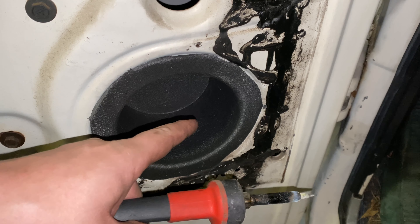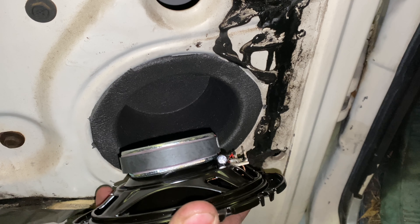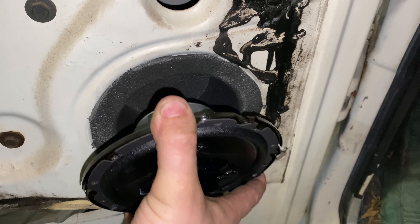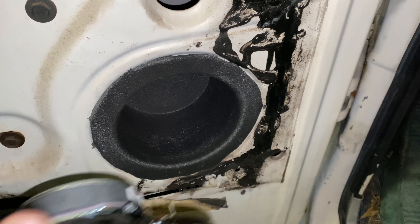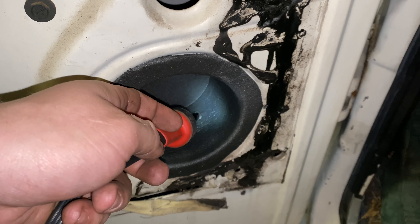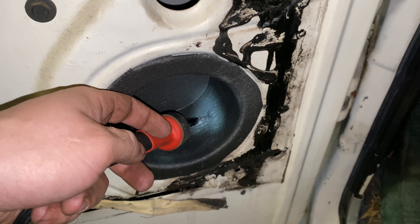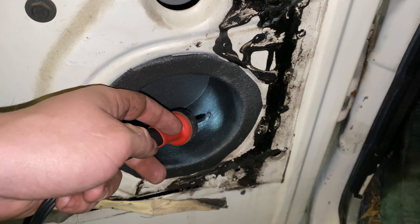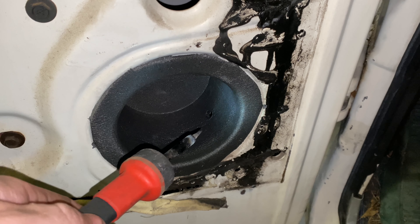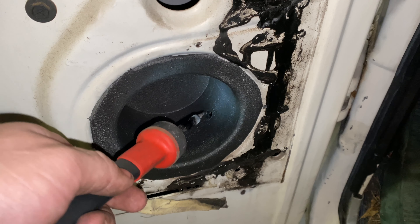Now with this installed, we've got to have a hole to run our wires through to hook our speaker up. I grab my speaker and set it up there to see where the terminals are going to be — on this side, closer to the front of the door. I want it down at an angle in the corner so the wires can come up, but if any water gets on it it's not running into the cone — it's going to run down and away. So I just poke a little hole through it right about here. This cauterizes it so it doesn't tear anymore.